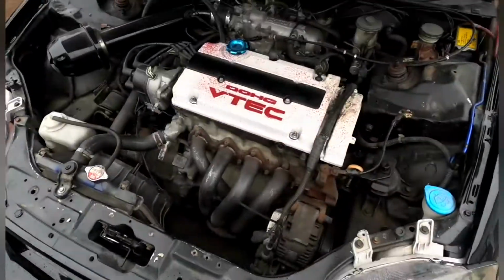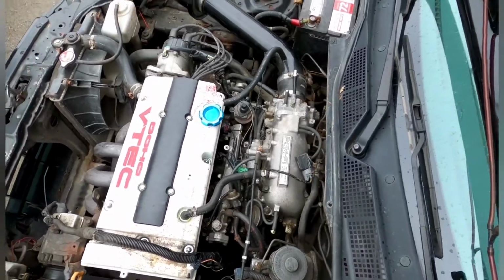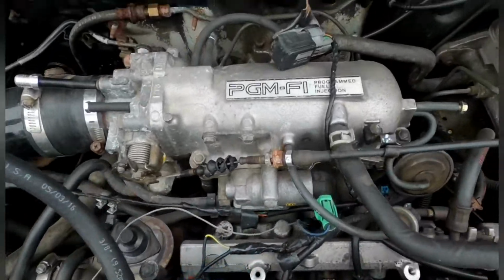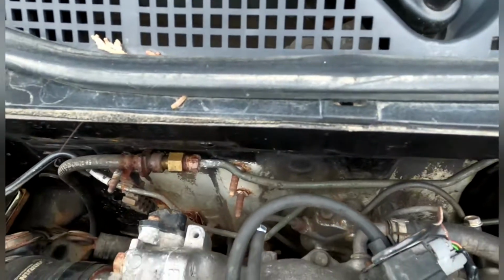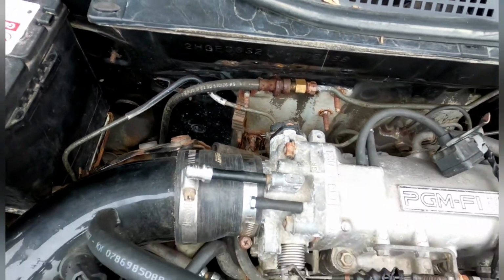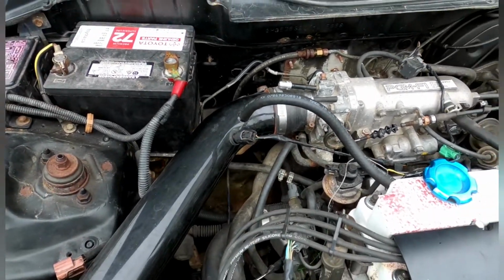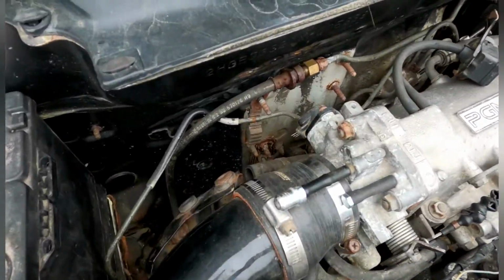So I'm actually gonna go over it for a buddy, and yeah, it's got a couple small things that need assessed on it, but for the most part, just gonna go over the wiring. And I had noticed right off the bat, the MAP sensor was here, which is totally fine, but then looking at the TPS wiring, there is no TPS wiring. So going to get a new TPS in it and recalibrate it. I'll show you guys how to do that because it has to be 0.45 volts closed and 5 volts wide open throttle. So I'll show you guys how to do that.